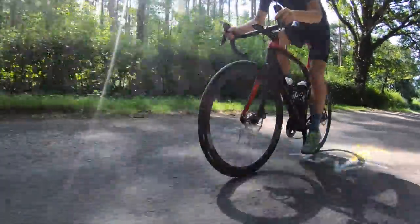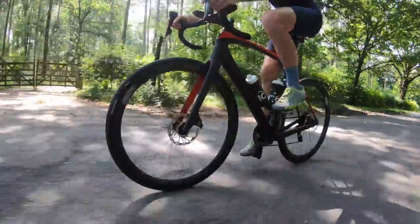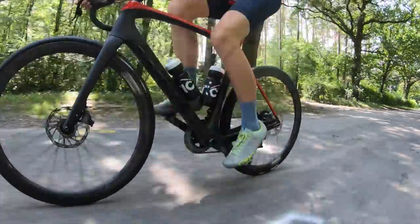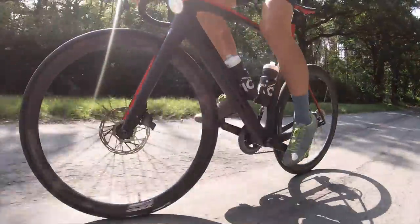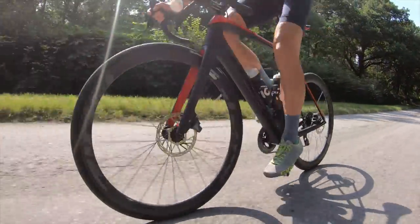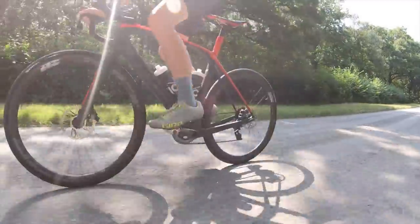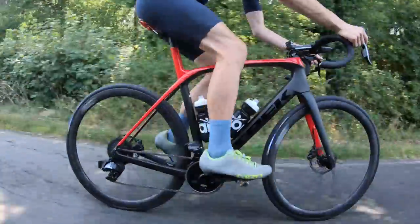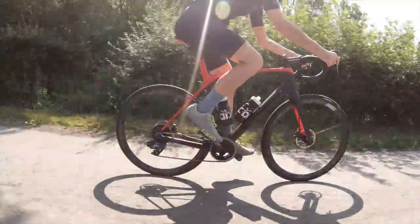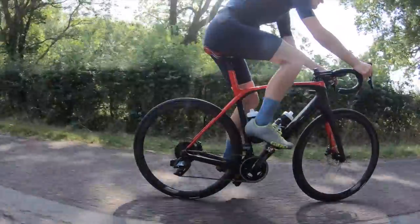But with wide tyres there's no need to run high pressures anyway. I run these at 60-65 psi for my weight and that's more than enough — I could probably go lower to 50-55 psi on rougher roads. It provides exceptional comfort and very low rolling resistance with no squirm, because the wider rim profile gives a really nice foundation for the tyre. These wheels have been excellent over four months: lightweight, very fast, very stable in crosswinds, easy tubeless, and the benefits of lower pressures.